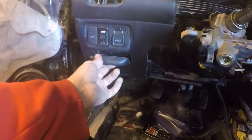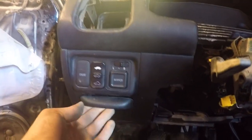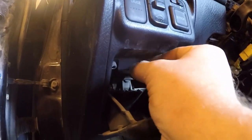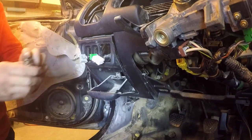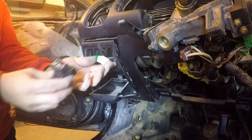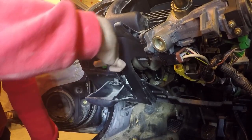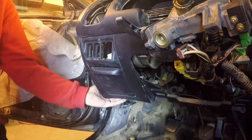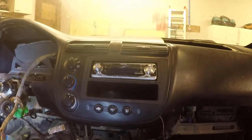According to the steps, the next thing is to take out this ashtray/coin holder. There's just one screw in the back that's got to come out, and we can disconnect the wiring harness for the sunroof, mirror, and all that stuff from the back side. The easiest thing was to reach in from the back and push these out until they came forward, then disconnect them. Now move this wiring harness out of the way so when we pull the dash it doesn't snag anything.